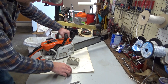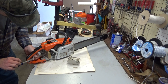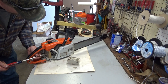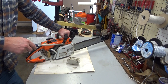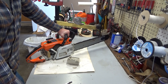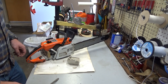The other issue Jay noted when he got it back was that it leaked oil — he said he'd get a pretty good puddle after it sat in one spot for a couple of days. I got everything apart, and the long story short: this is one of those saws where the bar studs capture the inner plate, and that inner plate had warped just a little bit. Oil was running back behind the plate and filling a couple of pockets, then slowly running back out. Over a couple of days you'd get a puddle — not much when you measure it, but when you measure it on the floor, it's a mess.